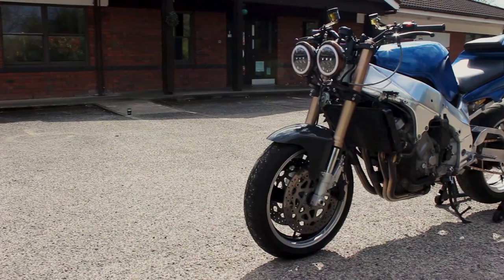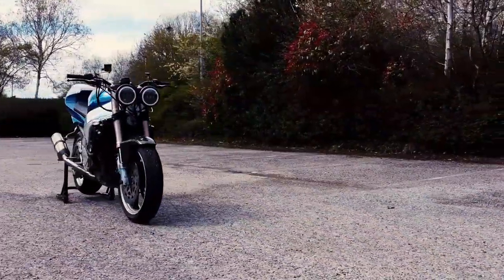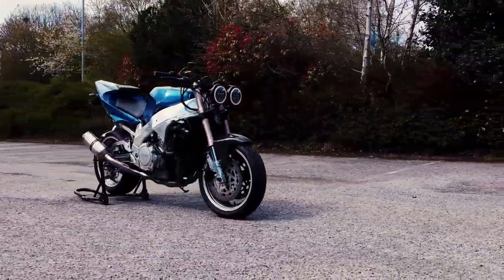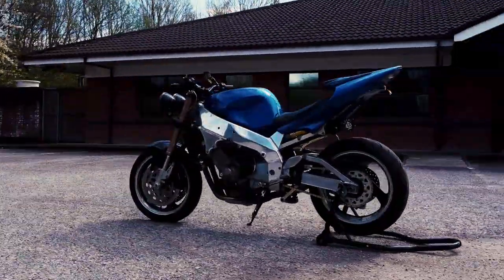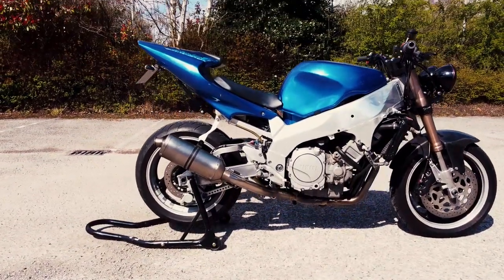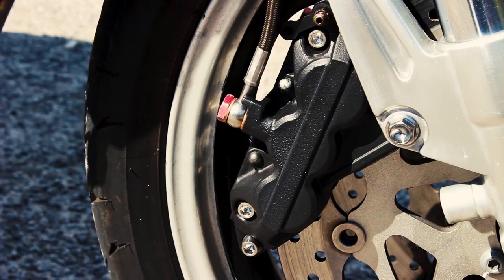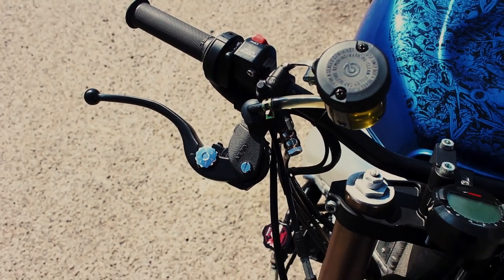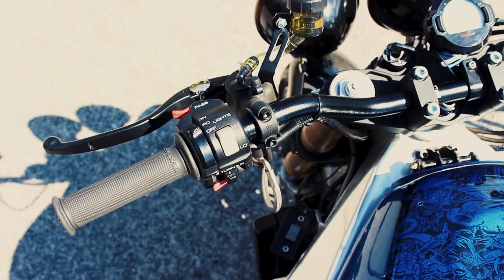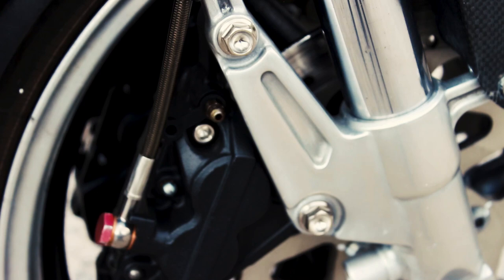This is how the bike sits at the moment — it's 99% done, but there are a few things I'm still thinking about, like paint, changing the rear seat unit, bar ends, and mirrors. In general though, I've done a lot of work. I've rebuilt the calipers and had them Cerakoted in black to match the new top yoke and bottom yoke. I've changed the brake master cylinder to an R1M and the clutch to an H2SX master cylinder, replaced all the black hoses with clear hose and clear reservoirs, and changed whatever bolts I could to titanium.